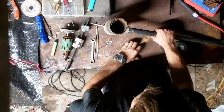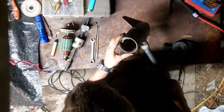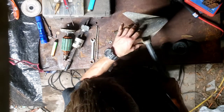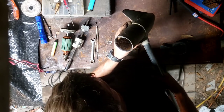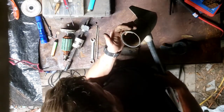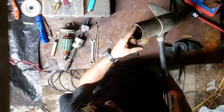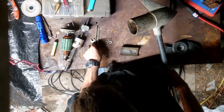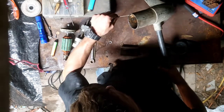This is going to have to be re-glued back down with some really serious glue. Then if you look inside, you've got your brushes. The tricky part is getting the rest of this apart so you can get to your brushes — that's going to be the next challenge. It looks like this is just pressed in, so you're going to want to be careful not to beat on this too much, because if one magnet is loose and the other isn't, you'll break that other magnet loose.